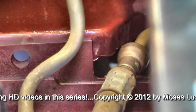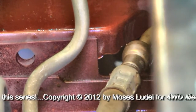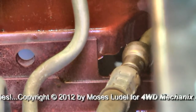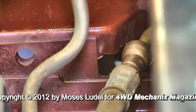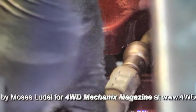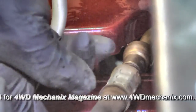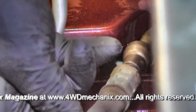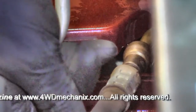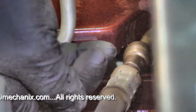One of the more difficult fittings to disconnect is the coupler on the lower hose for the automatic transmission. As cramped and crowded as that fitting is, we'll wait until we're lifting the radiator out to actually disconnect that hose from the radiator elbow. This hose is vulnerable to chafing against the steering gear — this is an original equipment hose, and I can feel on the backside that it's got a notch in it. I may go ahead and replace this hose before it blows out in service.